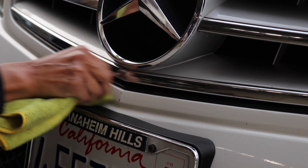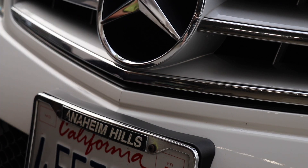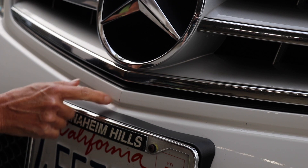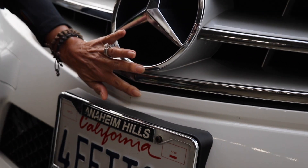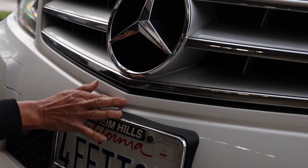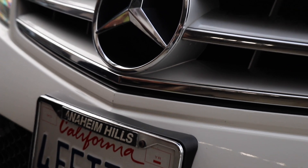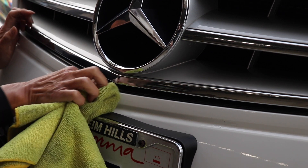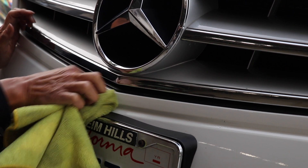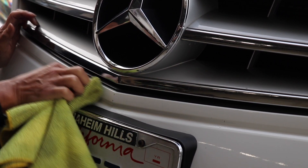Stop and reassess — is there still more transfer, or has it actually taken the paint off, revealing the black plastic underneath? If it's black plastic underneath, it may be damaged. You don't know until you know. That's the tricky part of car paint scratch removal — you have to go in and figure it out along the way. Use readers and scrutinize the area very closely, but you can continue to rub.